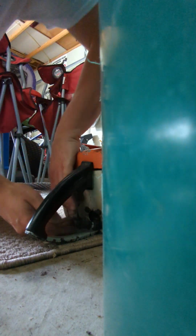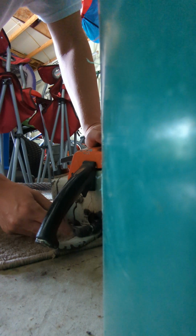So I'm gonna make sure we're touching the block on this thing. Sometimes that's the difference. Yeah, I'm still not seeing anything, so that's not good. Nothing. I'm gonna try the on and off switch again the other way. You know what? Nothing. I'm gonna grab a new plug real quick. This one doesn't seem to work. Or the coil's bad.